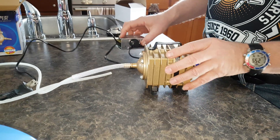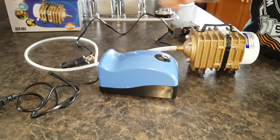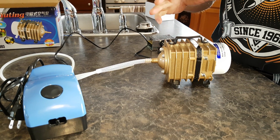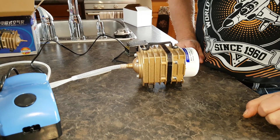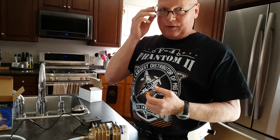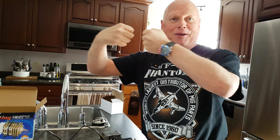This works good for a lot of smokers. If you've got a leak in your lid, a lot of leaks in your smoker, this pump is more than adequate — it works very well. The Yoder is sealed so well that inside the Yoder cabinet itself it pressurizes the inside. The only escaping air is going out through the stack and up through a little hole at the bottom where the pail is for the grease trap. So how do you get the air forced into it in order to have it burn properly? You need more air because you've got two airs combating each other, and you need to make sure the air from this pump wins against the Yoder fan they have in there for the fire pot.